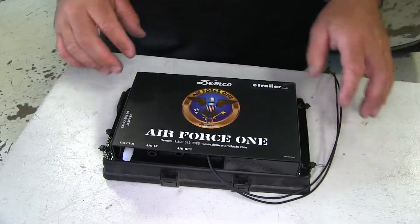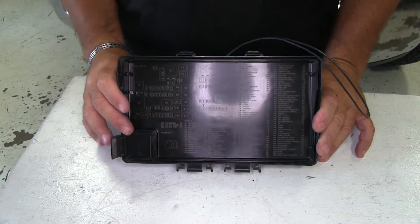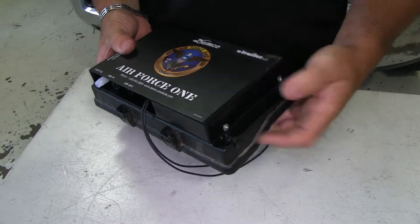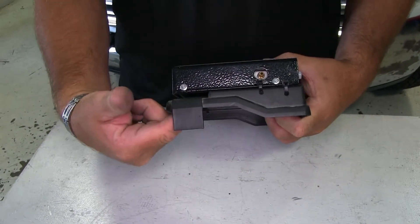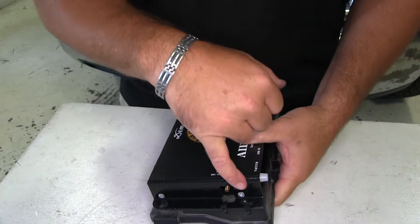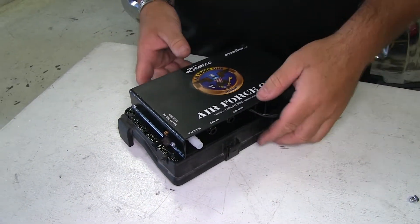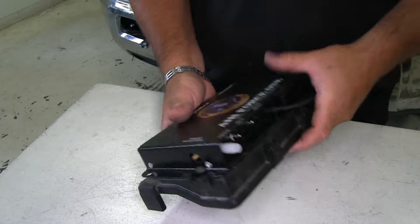I started with my operating unit. First thing to do is find a place to mount it. I actually chose to mount mine right on top of my fuse panel lid, right next to my battery. What I did is I just drilled a hole in the top and a hole in the side and ran a zip tie through it — zip ties come in your kit. I didn't drill through the other side because that's where a bolt comes up. So I drilled the second hole right there, which keeps it on tight and still gives you room to access your fuses. If you need more room, you can just pop your lid off.